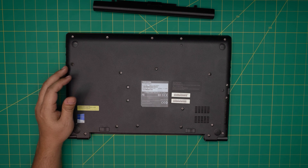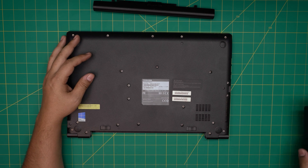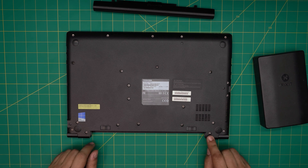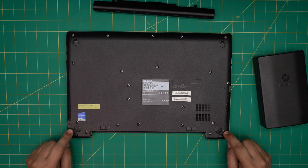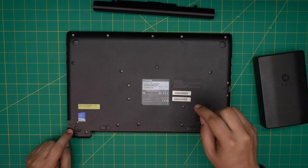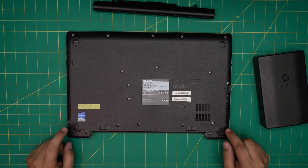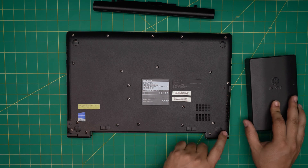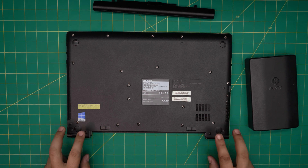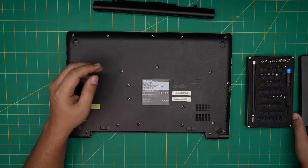Once you remove the battery, you need to remove the bottom cover. This cover was removed before, so note there are four long screws — one long screw has to be beside the battery in these two places. I placed the third and fourth longest screws by the hinges where there will be no harm done. The short screws are there to hold the whole thing together.